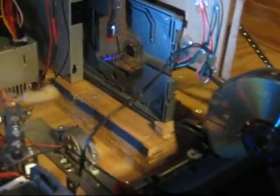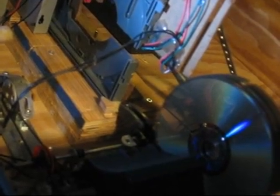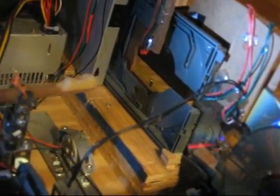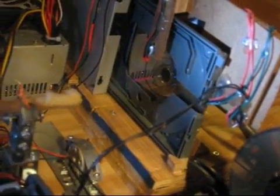There's the disc coming out. The arm swings around and grabs it. Now the disc tray will slide in, slide back out to the correct position. Disc is ejected. The arm moves there to block it from rolling too far. The arm then cycles back in, grabs it, puts it in. And often they require a little nudge at the end, so that's why the arm swings around again.